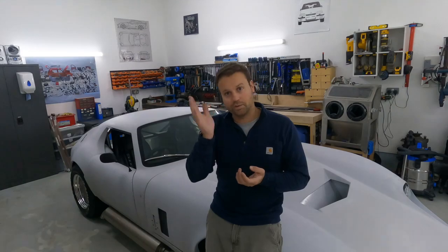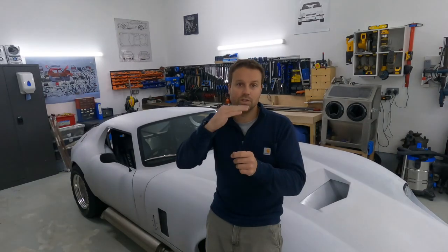The second reason the dashboard needs to come out is the fuel gauge is not reading - it's stuck around about two-thirds to three-quarters. I've tested the sender in the boot and it's not the sender, it's the gauge. I need to check the gauge, and when I get the dash out I can get to it from the back. There's also a small calibration unit which you can program to tell the gauge where to go on particular readings - that may well be faulty.